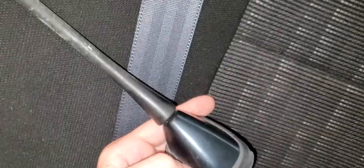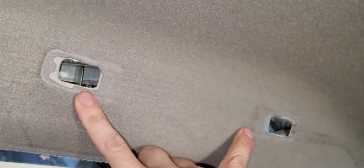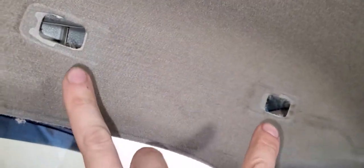It was fairly simple getting this antenna base off of this car. The minimal stuff you have to do would be this door handle right here. You want to pop out the sides and then basically pry it off. There's two 10 millimeters to get this off, so that's your first step. You pry this off and pry that one off.